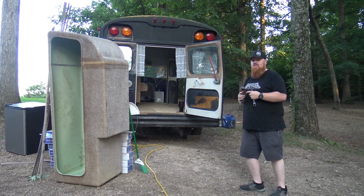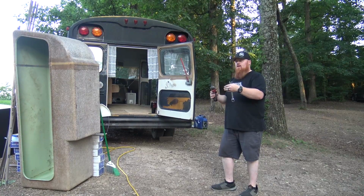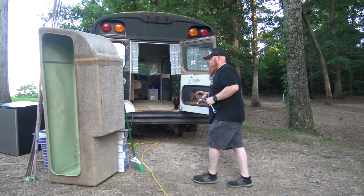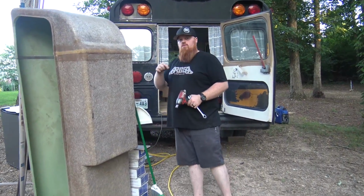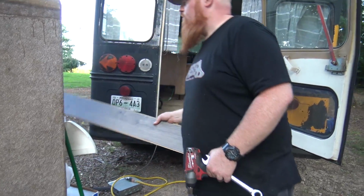We got 6 bolts holding in the couch. What we're going to do is we've traced out the feet on the floor of the bus, and then when we lay the laminate floors that we got, we have those traced out, and we'll just cut it and leave a little space for the feet, because I don't want to bolt the couch to the laminate floor.